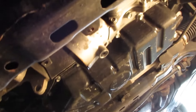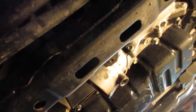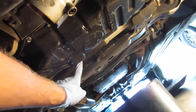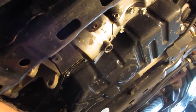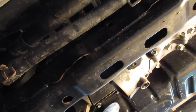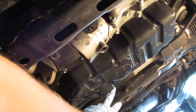I might just go hand tight on that. It turns out the underbody tray did leave an opening. I'm assuming that this is the oil pan right here, and there's a bolt on the other side — feels like maybe a 17 right there. They left an opening for that, but you have to take it off to get to the filter. So why leave an opening for that if you have to take the pans off anyway to get to the filter? Who changes oil without changing the filter? Probably a lot of people, but I'm not one of them. So that's kind of half-assed, but whatever — they came down fairly easily.